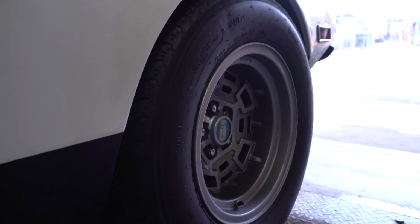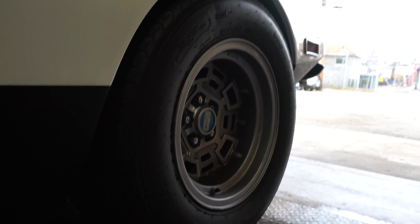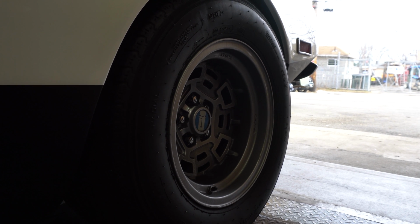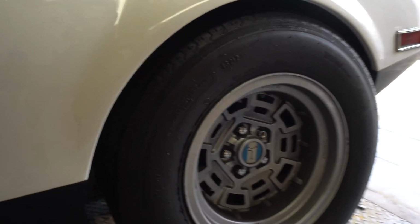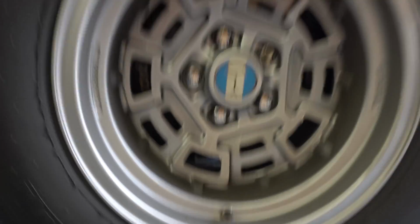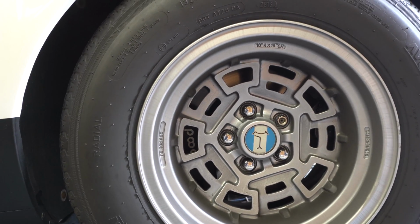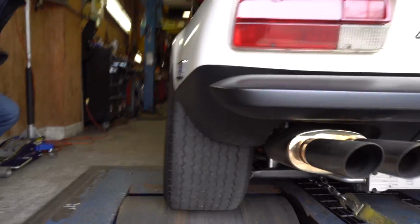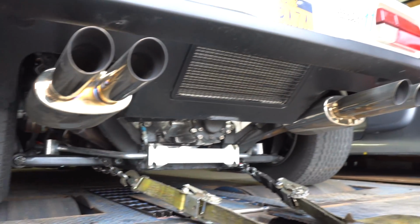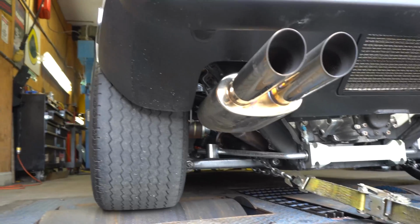What size tire is that? It's interesting. This setup is actually for a Cobra. It happens to fit a Pantera, but the Avon tires are really the best ones to run on it because these are actually 15-inch rims. I have a very limited tire selection. Almost every other Pantera you're going to see has aftermarket aluminum rims that are made to look like these, but these are the real magnesium ones. Because they're 15-inch, you really have super limited choices, and no one makes tires for those these days. They're 295s. The guys with the aftermarket rims will run like 315, 325.